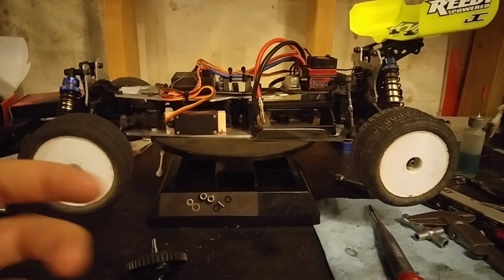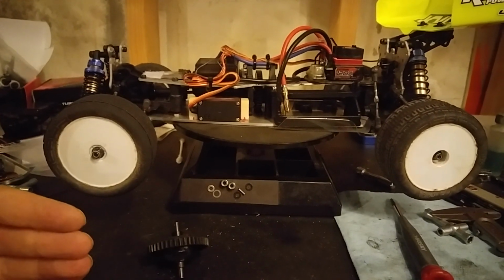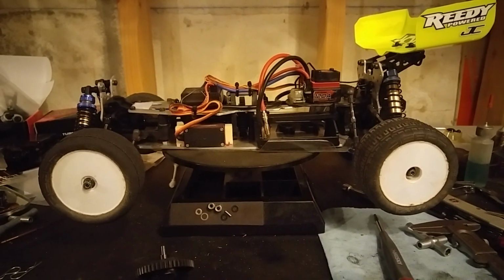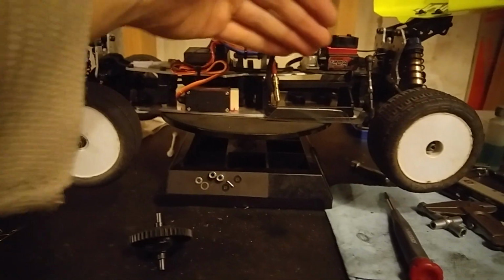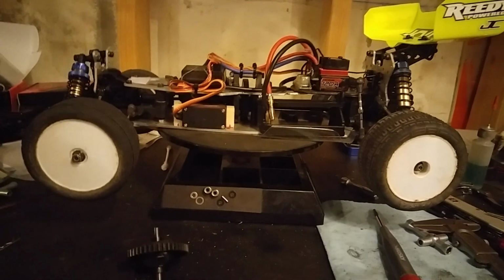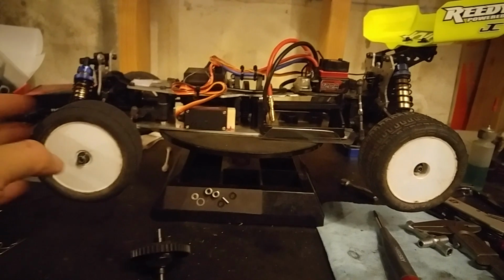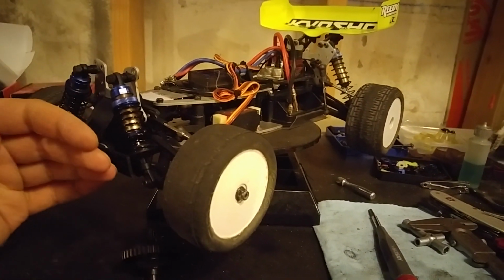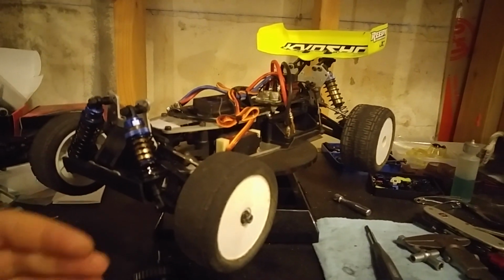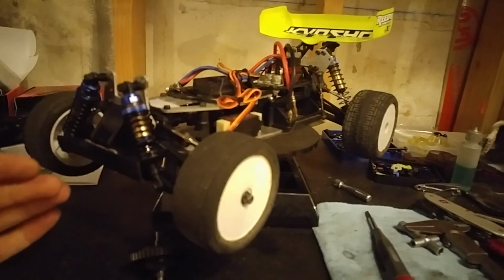You can sort of hear or see or sense, as you mash the throttle from a dead stop, how the car takes a little bit to get moving because it's distributing power through the center diff, which is exactly what you would want on an actual high grip track, where you're getting on the power really hard coming out of corners. So between what I did with the bumper, which is a pretty simple fix, and with the drivetrain, this is a much, much better car now than it was when I ran it at the Vintage Nationals last year.